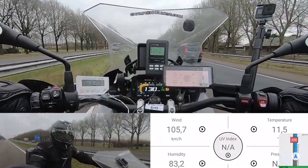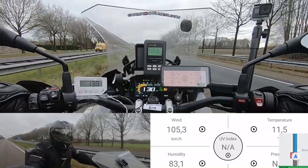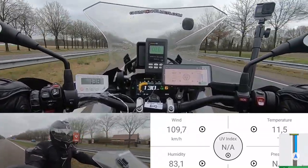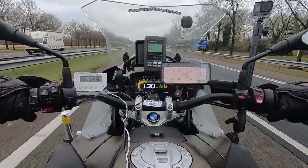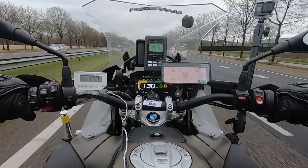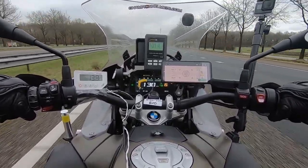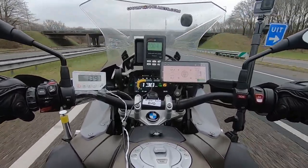Now let's have a look at how they performed in the road test. Our temperature meter measured the air in the helmet to be up to 2 degrees higher compared to the outside air, which means that the ventilation points are doing a great job at keeping the helmet cool. This earns the helmet 3 stars, placing it in the middle of the list along with the K3 and the EXO 491. The Qualifier DLX, with a temperature difference of 8.5 degrees, was by far the weakest helmet we tested.